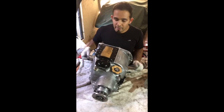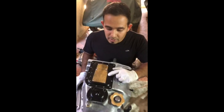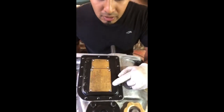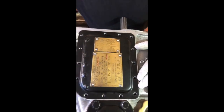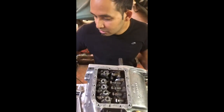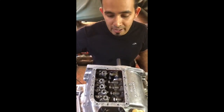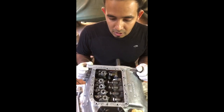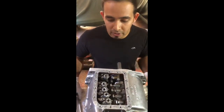I'm going to show you the plate over here — if you come in close you'll see it says Daimler and Company Limited. They made their own pre-selected gearboxes. If I open this cover up, it's very similar to an automatic gearbox, but the difference is that it does not change gears automatically. You need to change the gears just by bumping the clutch and shifting it into gear, but not pressing the clutch and holding it.